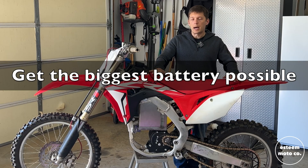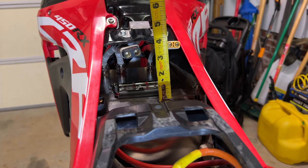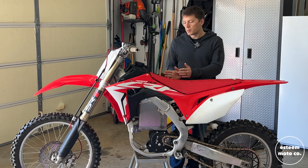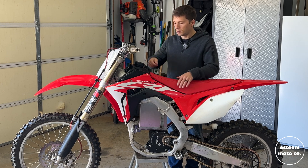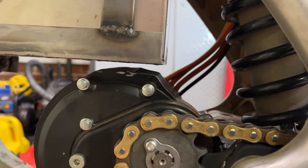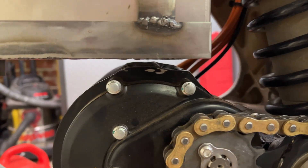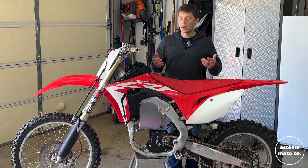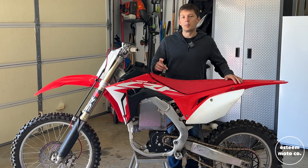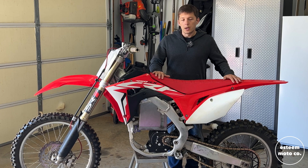Number three — this kind of goes back to the frame issue — I would buy a bigger battery. I put a 40 amp hour battery in this frame, but knowing how much space is above the battery, I could have gotten a larger battery that was simply taller and probably got another 10 to 20 amp hours out of it. With the perimeter frame on aluminum frames where they swell open, you can drop a battery directly down into it. I cut the top of the motor off — you can see that in some old videos — which dropped my battery down about two inches, giving me another two inches above where it sits today. A bigger battery would have cost more but given quite a bit more ride time, and certain larger batteries have more output amperage, so you could have more power if your controller can handle it.